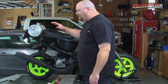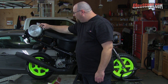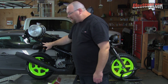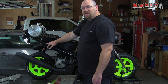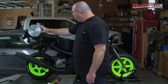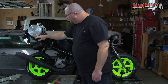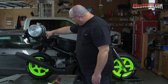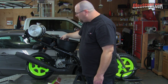Just while I'm at it, I don't know that I've really said much about this on YouTube, but you may notice I've now got a different gas tank in the back here. That is a two and a half gallon spun aluminum gas tank. I took my original tank out because it had a leak and I just didn't feel like trying to fix it. I had tried to JB weld it and that didn't seal it, and welding a used gas tank is kind of iffy, so I just decided to go this route. I kind of stretched the frame a few inches out back just to make it fit, and made this little storage compartment out of metal where my old gas tank used to sit, so now I can carry my oil around in here.